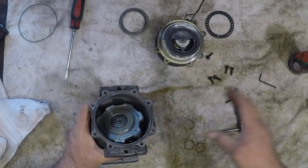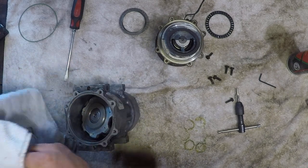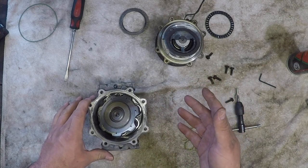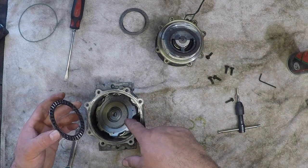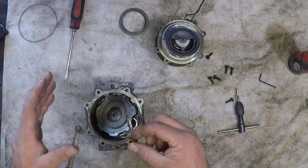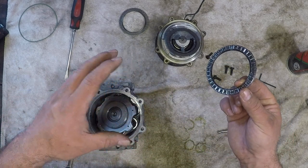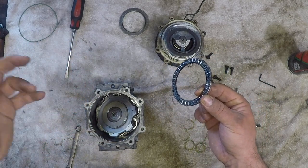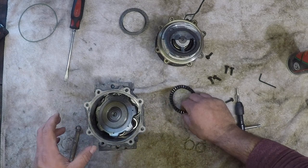Let that dry and clean it out. Your biggest thing is this needs to be pretty liberally lubricated — this is what's going to lubricate the bearing, the wobble plate, and all your pistons from now on, instead of the oil that was in the freon. Make sure you put a good amount in there, but you don't want to overpack it because that'll just put more drag and wear on it. For as much as these get used, it's not something you're going to use every day.